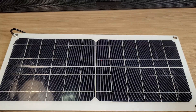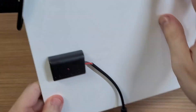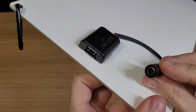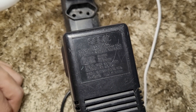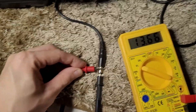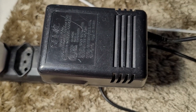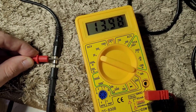Now I got a new solar panel, and this one is much stronger. It outputs 12V at 30W. You must be thinking that's a little bit too much, but actually the original Genesis AC adapter outputs a similar voltage. When the Genesis is turned on, the load will decrease the voltage a little bit, and besides, the console has an internal voltage regulator.